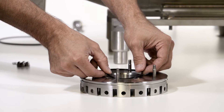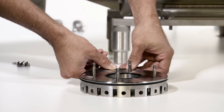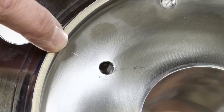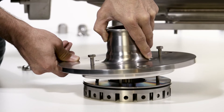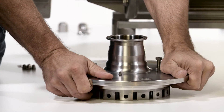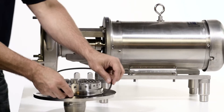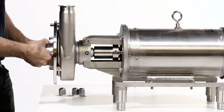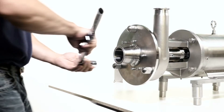Install the inner and outer stator o-rings. Be sure the bolts have been backed out. Find the markings stamped on the stator and on the back of the cover. Install the stator onto the cover, making sure to align the markings so they are face-to-face when assembled. Tighten the stator nuts with a torque wrench. Install the cover o-ring, then install the cover stator assembly. Install the cover nuts and washers and tighten with the torque wrench and socket.